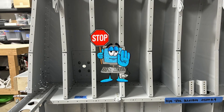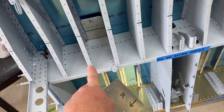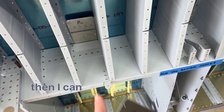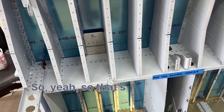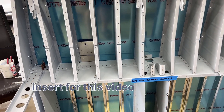In that last section you saw the doubler for the antenna in the third rib from the left — it actually should go in the second rib bay from the left, to give the 36-inch spacing from left to right that you need. I wanted to clarify that. We'll keep going, match it up to the spacer, then drill through the skin and do all that. That's what I'm doing there — it's starting to come together.